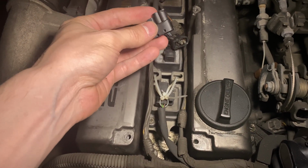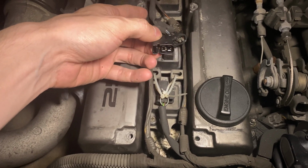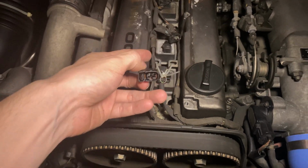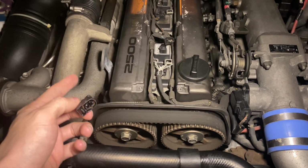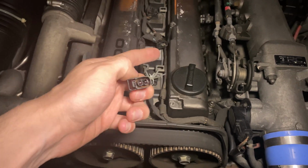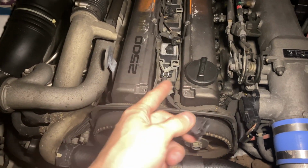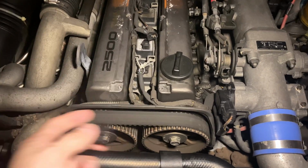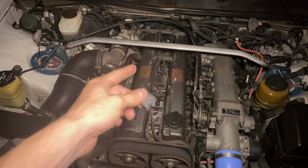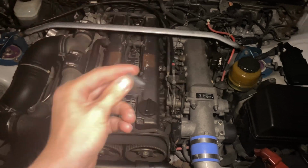this one's going to go this way. I would pull out one wire, put it directly in here. Pull out one wire, put it directly in here, just so you don't mix them up. Again, I don't know what it would do, but probably not good. Don't mix them up. And if yours are disintegrated and they fall out, there's probably somewhere you can go online to figure out exactly, oh, coil 1, green's on this side, whatever. You could probably figure that out all online. But for now, all mine are still kind of intact. I'm going to go ahead and put them all into here.